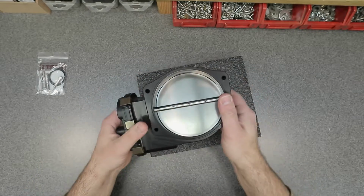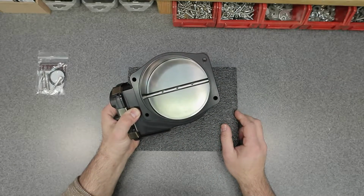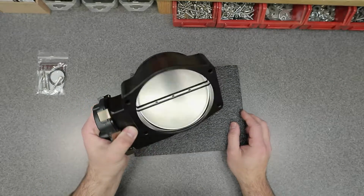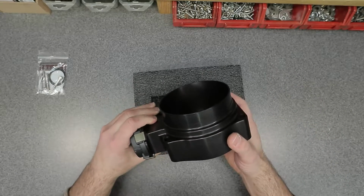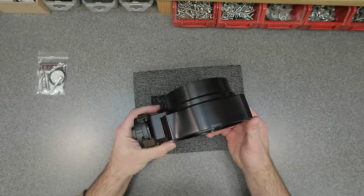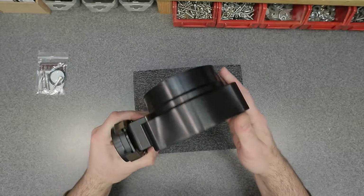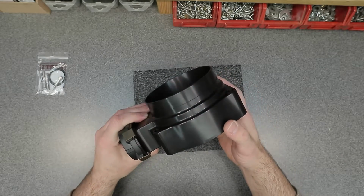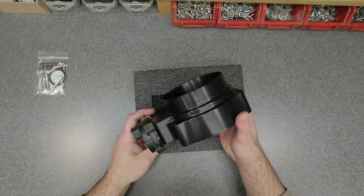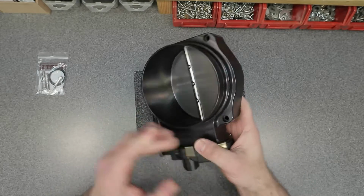So this is gonna go on my LS9. I have a max effort ZR1. It's making over 1,000 wheel. So I want to see if I can get some extra gains from this. I want to get more airflow into the car, possibly add more surface area on the air filter, open up the snout a little bit from what it is now, and obviously add this in there and see if I can get any gains, as well as going down in pulley size, so going from a 2.25 to a 2.20 pulley. So now let's take a look at some measurements.